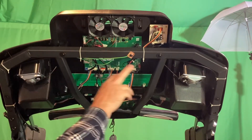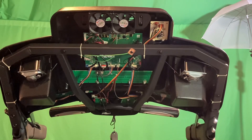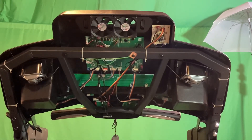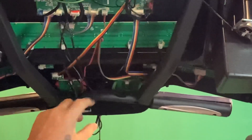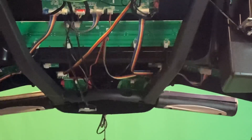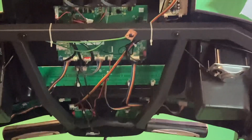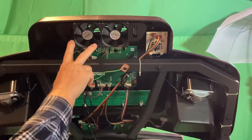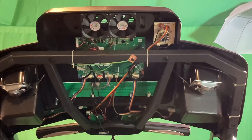You're going to have to remove some screws here. It's a shame because my display board works but I've got to show you. While we're here, let me go over a couple of buttons: this is your stop and start button, this is what's called a safety key module — sometimes that breaks, and when you put the safety key in it'll feel wiggly. These are your button boards and they all run to your main display. This is your upper set of button boards, speaker, soundboard, and fan.